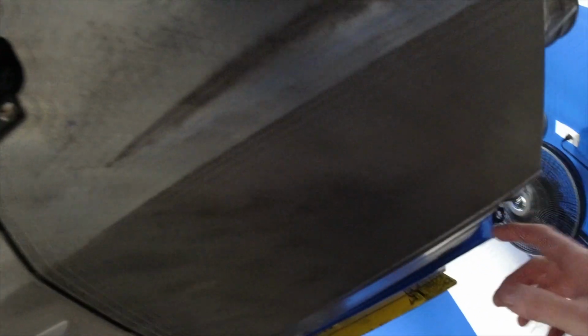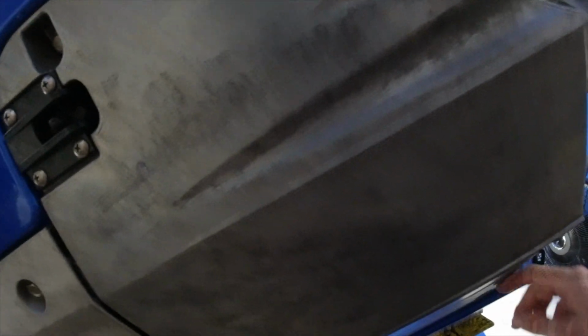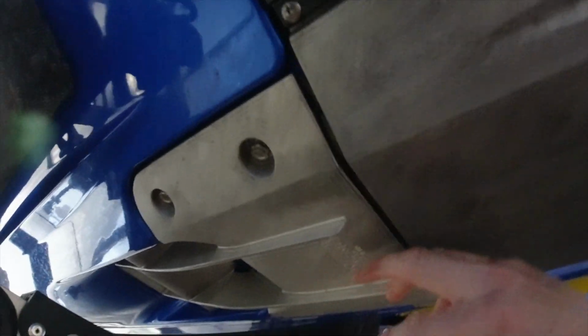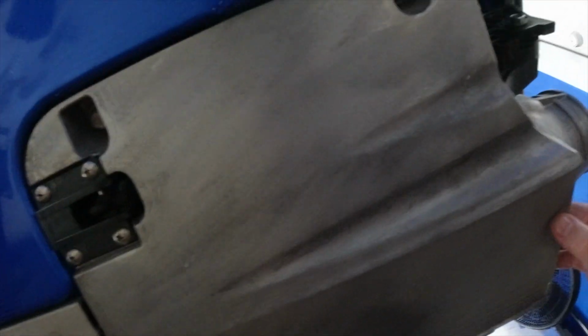Alright, got everything tightened. The one I loosened on the ride plate, once I got the 3 other ones somewhat tightened down, I loosened that up and put blue Loctite. So these 4 on the ride plate have blue Loctite. The 6 on the intake grate have blue Loctite. Now I've got to check what the torque spec is. Torque these down, but it's ready to go.